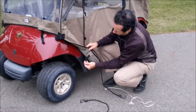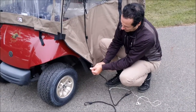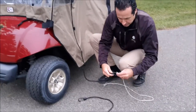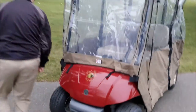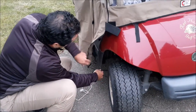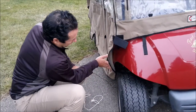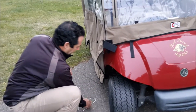right through the wheel well. Now on your bungee cord there's a hook, and a little bit of a loop. We're going to slip that bungee cord through there with our simple little tool — it's very simple to toss it underneath. Then all we have to do is pull the bungee cord through and attach it to the other side through the wheel well. And you can see what that's going to do — it's going to start to pull the cover closer so that we're not going to get any drafting at the front of the cart.